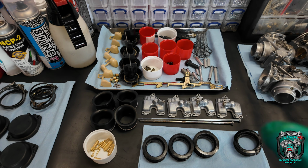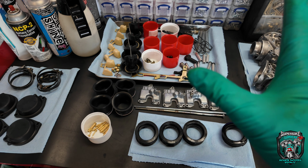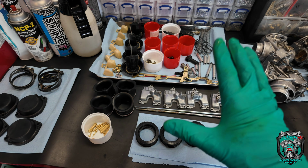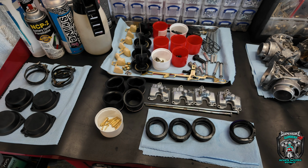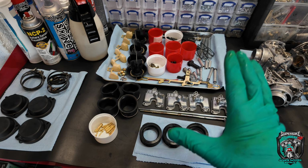I've got a good couple of hours of fighting putting these back together, and then we'll get them on the bike. I've just had a look. We talked earlier in the video, I think, about oil contamination with fuel. I've just looked at the sight glass and it seems to be overfull, and it does smell a bit petrol-y in there, so I'm going to change the oil before I try and run it.